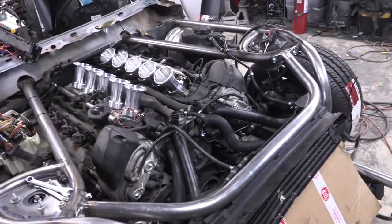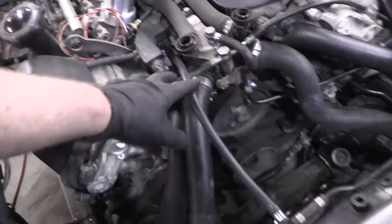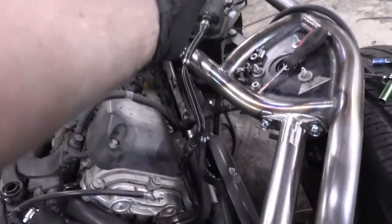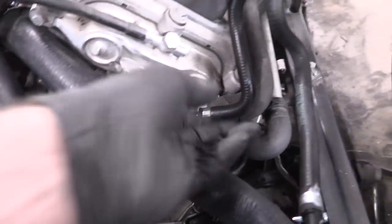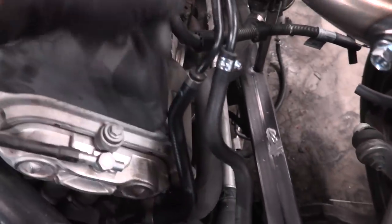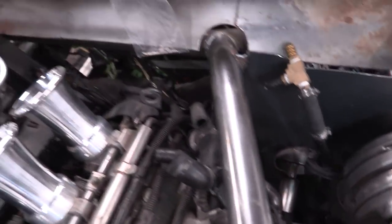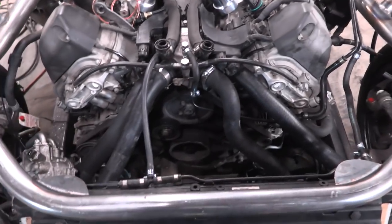The time-lapse cut out about 30 minutes into working, but I got the cooling system completely done. There's a banjo bolt down there that runs along to a T system that also connects to a couple of spots on the radiator, then runs along the side and up to our reservoir. There's another banjo bolt here that runs down and goes up against a hose and out to the reservoir as well. Then the two big main lines come off the front of the block — the higher one goes to the bottom of the reservoir, and the lower one runs along the side of the car in hard lines because it gets close to the exhaust manifold, then snakes back around and goes up to the back of the engine. If all my research is correct, that should basically delete the heater core. That's the cooling system done.